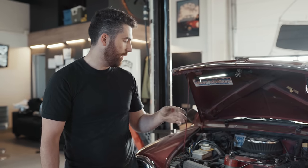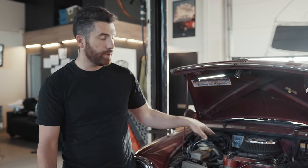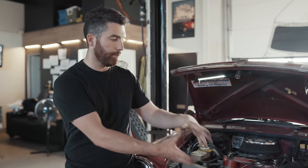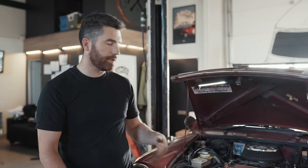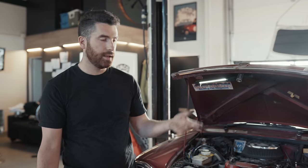It's all really important to get the right brake pedal feel, balance for the braking system, and just general function. The last system that's commonly used, pretty much from all of the fuel injected cars from the early 90s all the way up, is this system here, and this is with a booster. There also was a booster on the earlier cars. Some of the Coopers, the Super S's, have them. There were like a remote booster. Some of the earlier carbureted cars in the late 80s also still had a booster. Boosted systems are the most modern, most complex.